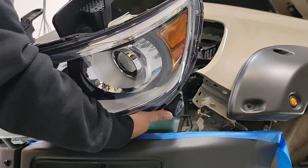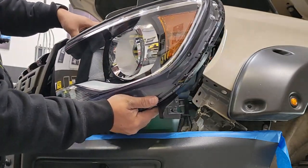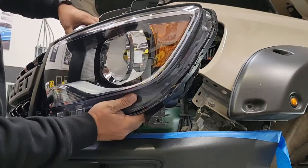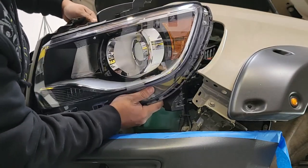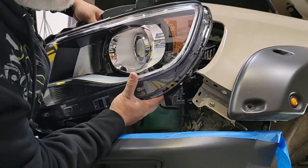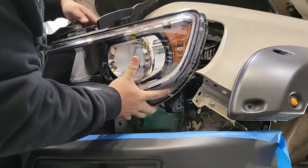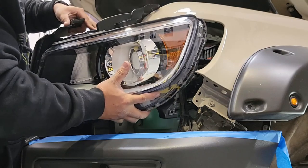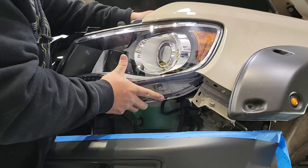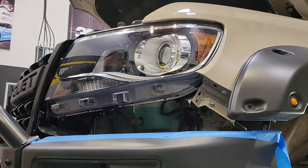With the factory assembly ready, we're going to plug it back into the harness the same way we did before. We're going to push the inside edge of the headlight just behind where the grille is, flexing the grille, making sure we don't catch the plastics on the edge of the light assembly at the corner. Carefully rotate that in, and once it clears the upper edge, it should fall into place pretty straightforwardly. Take your time, make sure you don't scratch the lenses putting it in — if you paid attention on the way out, it goes in the exact same way.